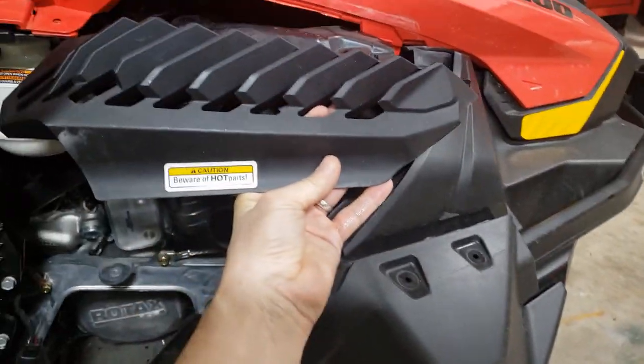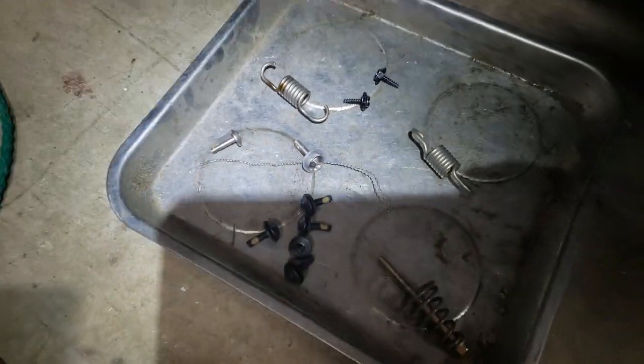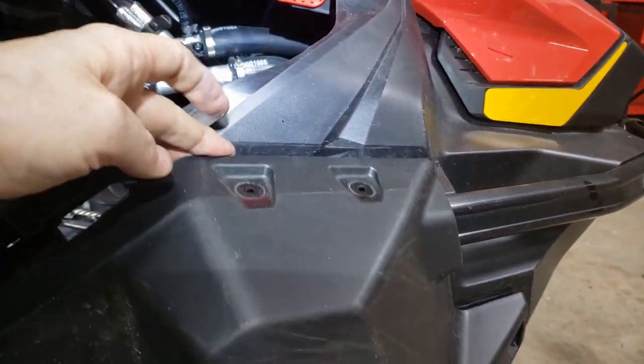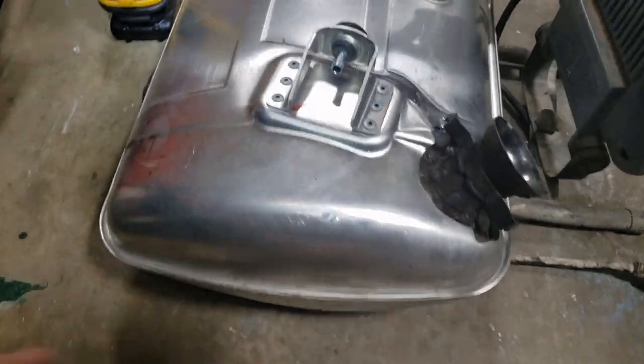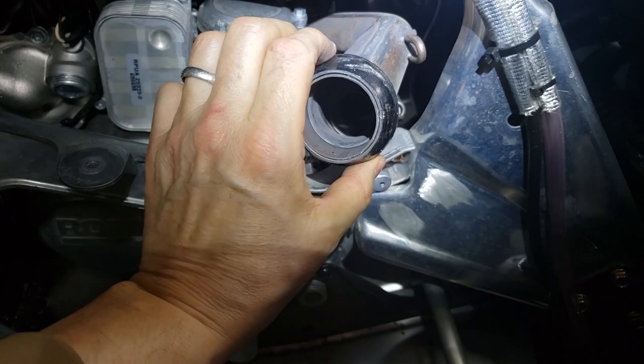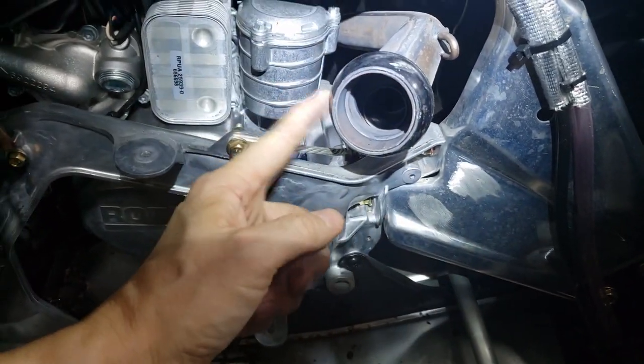Here I've finally gotten smart: I've taken that plastic exhaust part off, as I'm showing you, put everything in a magnetic tray — first project taking this apart, don't want to lose any parts. I loosened the side plastic of the Pogo cover just enough so that the mount of the exhaust would come straight out. Without removing those screws on that side Pogo cover, it wouldn't come out.